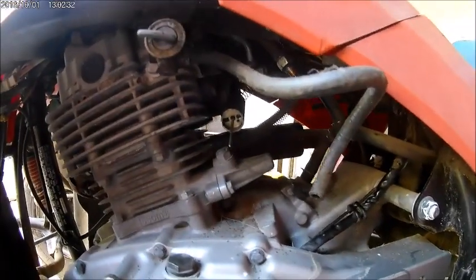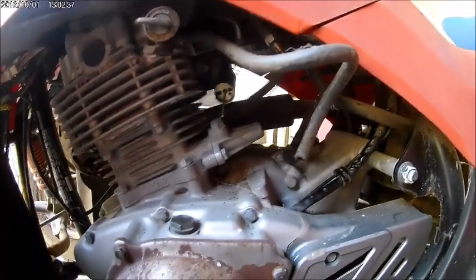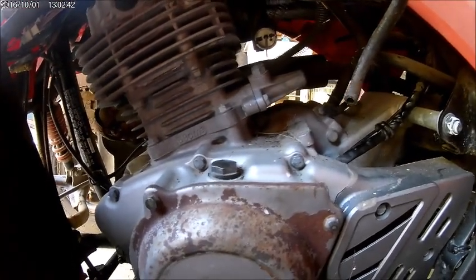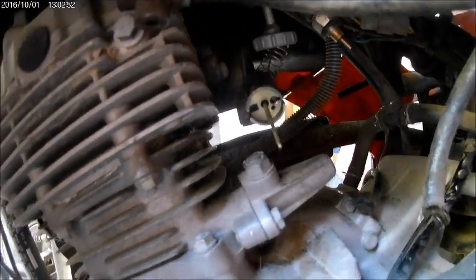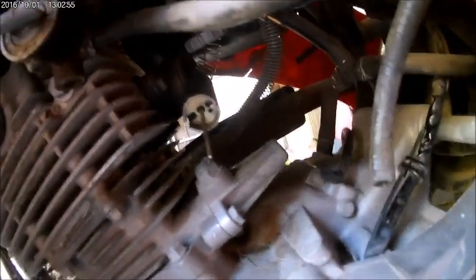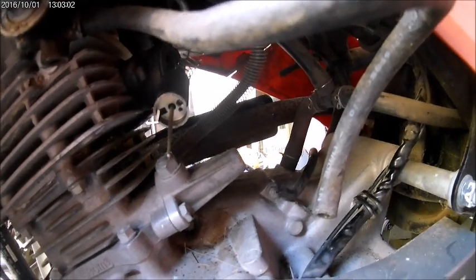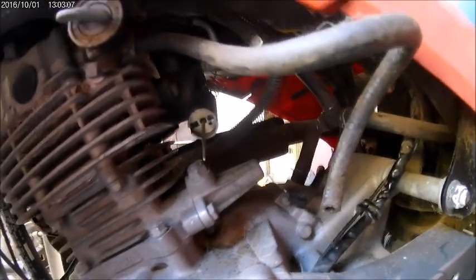So the last thing we took off is the fuel line, so that'll be the first thing we put back on. And then next thing is the drain line. It could probably wait to last, but if you're going to do it in the same order, the drain line would be next, then the throttle plate, and then the choke, right? And then squeeze it into the front, and then put the back on. So that's the reverse of what we did to get it off, and that's how we'll end up putting it back on, or some variation of that.